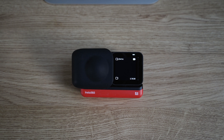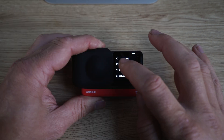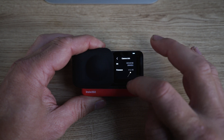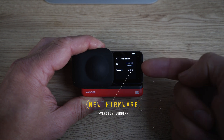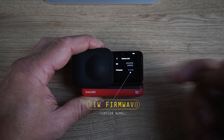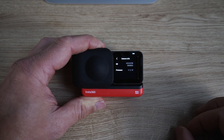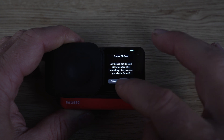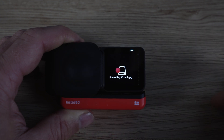The black screen's finished. The camera has now restarted and it's ready to go. What I always do once I've done this is go into camera info and check that the latest firmware is on — you can see the firmware version there. Then go back into the SD card and format the drive to make sure that the firmware installer has been removed.